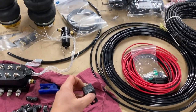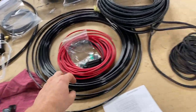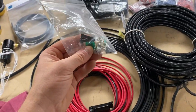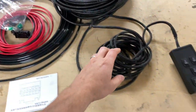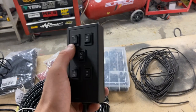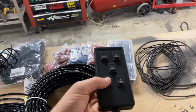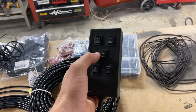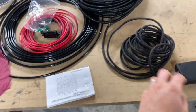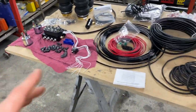We've got various fittings, the relay for the compressor which works alongside the pressure valve in the tank - I'll explain that in a minute - airline, various bits to make sure nothing gets damaged, and fuses for the compressor. The controller we've made from scratch ourselves. It was a blank box that we bought, and we've added momentary up-on-off-on switches, wired up so you've got front left, front right, rear left, rear right, all up and all down. That box wires into the manifold and controls everything.